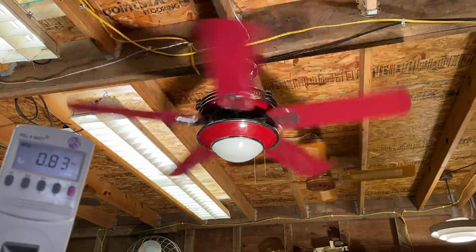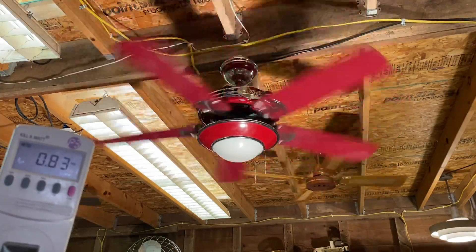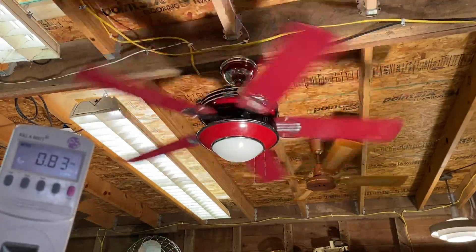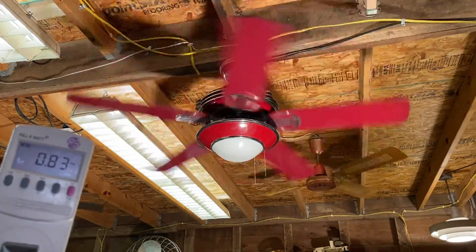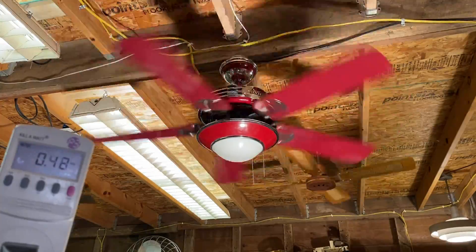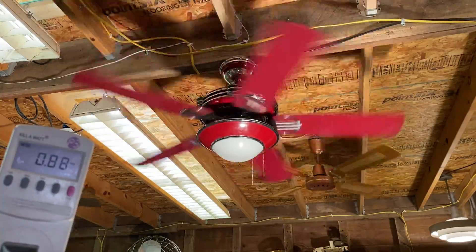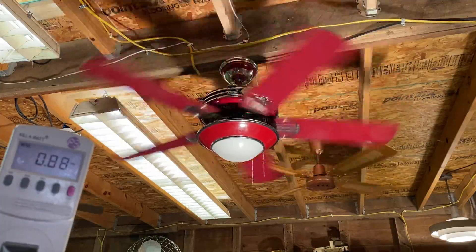If you find an 8-12-20 that's definitely going to get a good range of speeds. Right here I'd call it a backed-off high — it's up there in high but not all the way up insane, but it allows you to move air without the insanity. So at 20 microfarads, maybe not a 4-7-11 because those stalled out, so you wouldn't get a low speed.